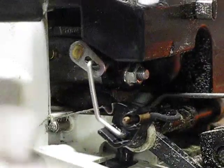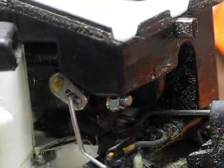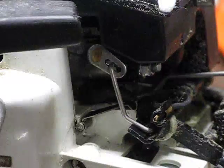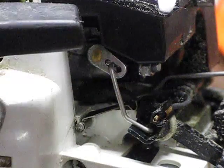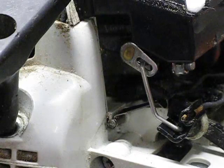When you pull it off, the fuel should be running out of there. If you tilt the saw, it should run out clean. If you've got spark, you've got clean fuel in the tank, and you have compression — check to make sure you don't have a blocked fuel line.